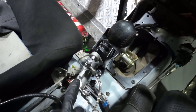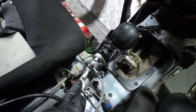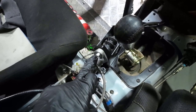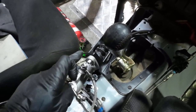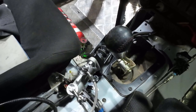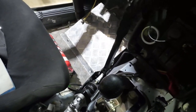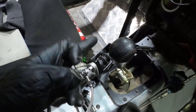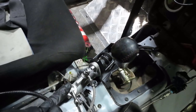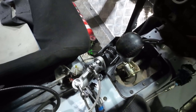This side here is the inlet into this little master cylinder. Fluid comes from the main brake master cylinder into this handbrake master cylinder, and then exits through here. When the handbrake is not being used - in its neutral position - this goes into bypass, so the fluid comes in and exits straight out to the back wheels. It works like a normal braking system. However, when you actuate the hydraulic handbrake by pulling the lever, a valve inside changes and it then sends pressure from the handbrake assembly to the rear wheels, either independently or on top of the pressure from the brake master cylinder.